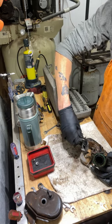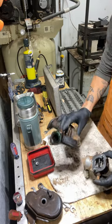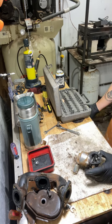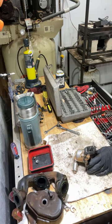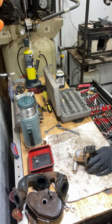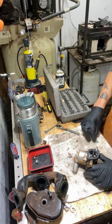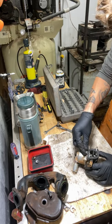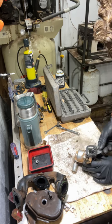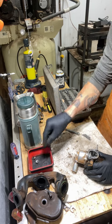The gasket holds these in too. I don't have a new gasket, so I'm going to try to clean this carburetor and fix it, which means I need to be careful with this gasket. I've got a little scraper tool — actually, a razor blade, go old school — and we'll see if we can salvage this gasket. Otherwise I'll be making one. It came off nicely. We'll clean that up and probably use some sealant when we put it back together.